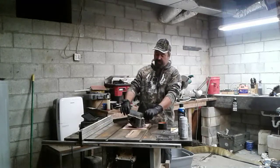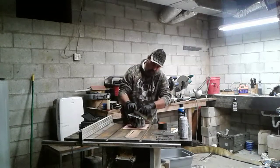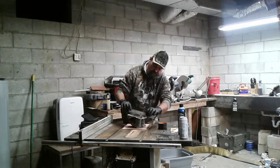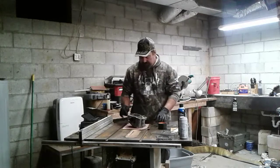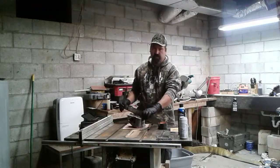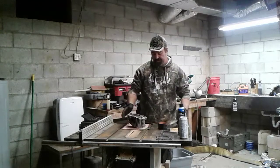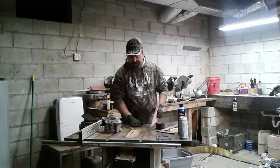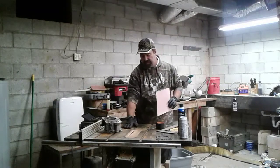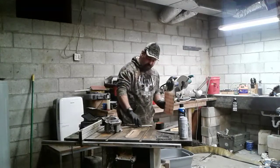What I do is I take a straight edge and check across the head in several positions. I look where the straight edge meets the head and make sure there's no gaps — like I said, this one has a gap right here. I use a couple of different straight edges just to make sure, measure twice. Once I've found the warped area, I use a flat surface, a machined surface preferably. You want thick metal that's flat, and check it to make sure there are no warps in the surface you're going to use.